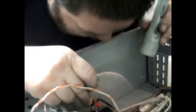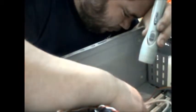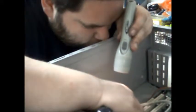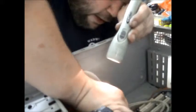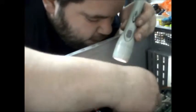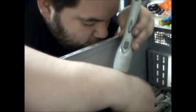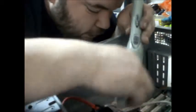Alright, LED. Put on that one. Especially since the power LED has got two separate connectors instead of joined together into two. What's this one? That's the power switch, that's right beside it. And I thought I'd somehow put the power LED on the wrong terminal. The LEDs don't light, and I know I've got them around the wrong way. Right. The reset switch goes in front of the power switch, and the hard drive LED goes in front of the power LED.